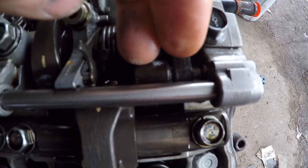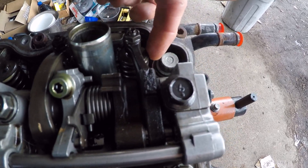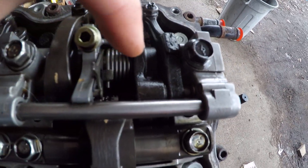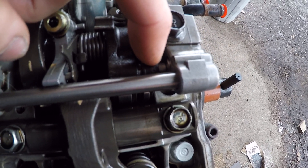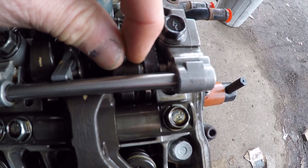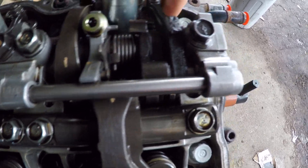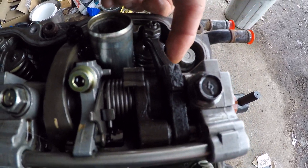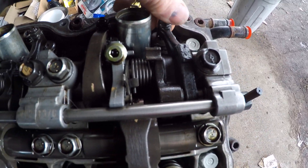You can see these two pieces here — one produces a small amount of press on the valve, so it slightly opens the valve. But when oil pressure kicks in from the solenoid at higher RPMs, this little pin on the inside pushes the larger pin into this spring-loaded pin cavity, which links these two bars so you get a full depression. Basically it switches which lobe the cam is using to achieve a full depression of that valve, increasing the air-fuel mixture coming in from the intake valve.